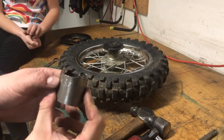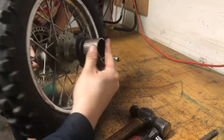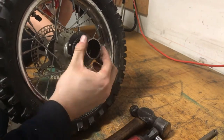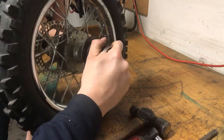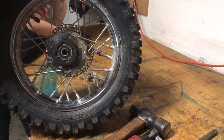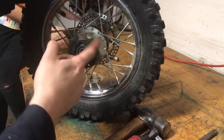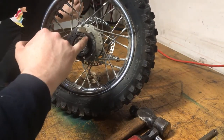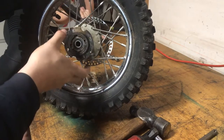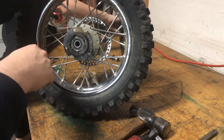So I made this and it pretty much mirrors what the tool is. I just took a piece of pipe that kind of matched this and cut the teeth to where it would mesh with the freewheel. I actually put the axle bolt through it, put some washers on it to keep this in place, and put a pipe wrench on it, hoping to break this thing free. And like a couple other guys on YouTube that you've probably already seen if you're watching this video, it's pretty much seized on there. So I'm going to do pretty much what the others did — I'm going to cut the outer ring off of this. And after I get the outer piece off, I may split the inner, or I may just take a pipe wrench, grab on the inner piece and try to do it that way, especially after adding some heat.